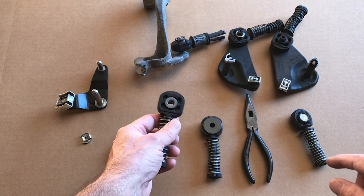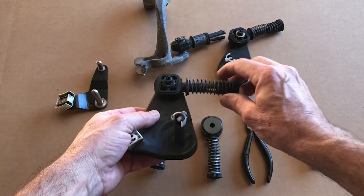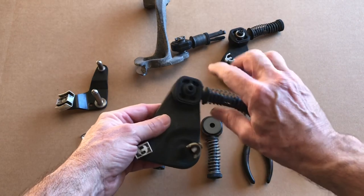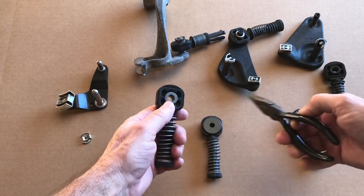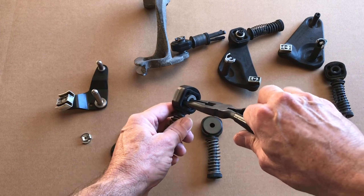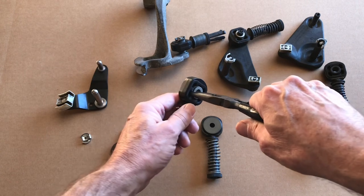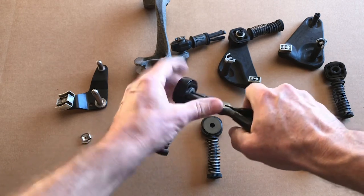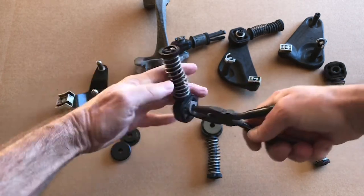You can also find square-headed cable ends on the side-to-side brackets from 2008 to 2020 or 2021 — those work fine, you just have to get them off the pins. We're going to take a side-to-side cable end from the early 2000s and gut it. To do that, stick your needle-nose pliers into the hole, grab onto the hard plastic insert, and twist to separate it from the rubber.